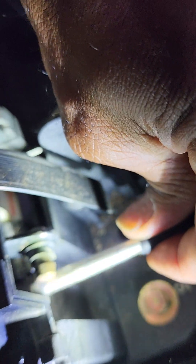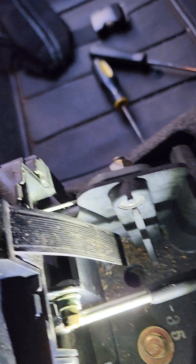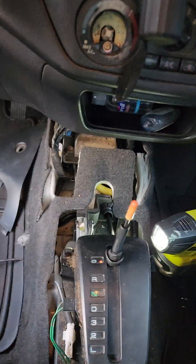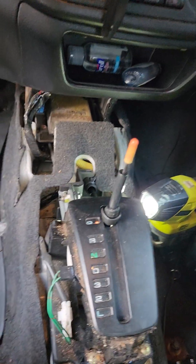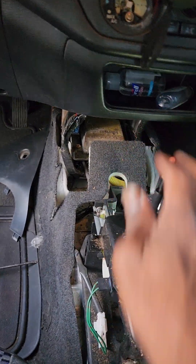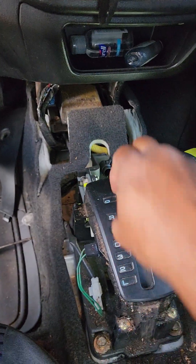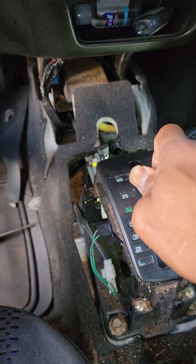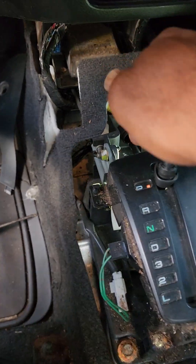This particular stiff cable here should be attached to something up here. I know that's the problem because you don't have a cable just sitting here loose. So we're going to get it attached, find out where it goes, and then maybe that'll help somebody else. On the 2008 Mitsubishi Lancer, the gear shift was just going up and down like this - not engaging in any gear. I was thinking it was the transmission, but it's because it's doing its movement but it's not attaching.